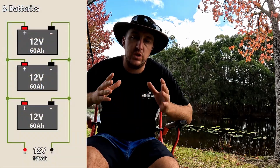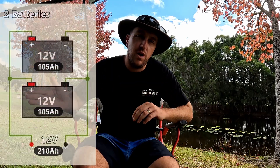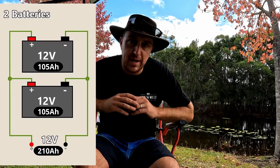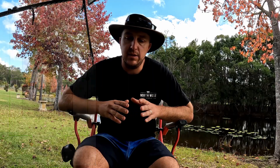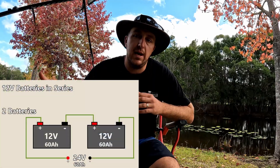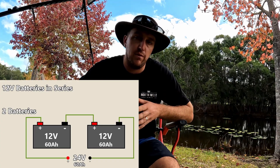It's not as common — it's typically a 12 volt system — but you can have multiple 12 volt batteries in parallel to extend your capacity. For example, we've got two 105 amp hour 12 volt batteries which gives us 210 amp hours of 12 volts. If you were to put them in series that's how you could get a 24 volt system, but if your van is running on 12 volts you don't want that. They need to be in parallel, but an auto sparky will worry about that for you.